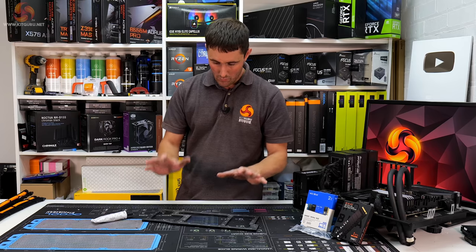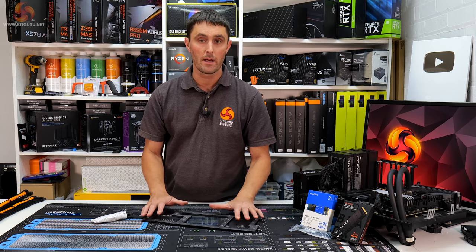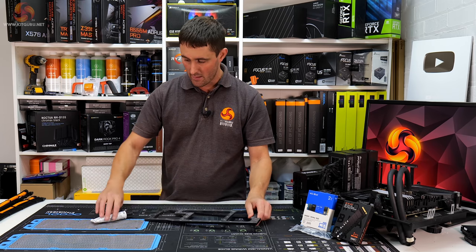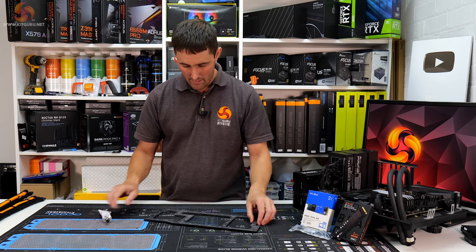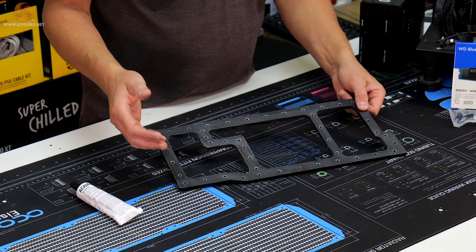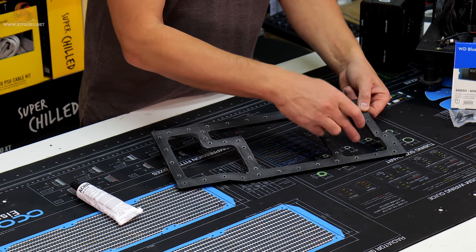Plan is now, as well as the 8mm central plate, I'm going to upgrade the top plate and the bottom plate also from 5mm thick to 8mm thick acrylic. And using this Acrifix, I'm going to permanently bond the bottom plate to the mid plate. I'm also going to add some baffles into this larger section here, and then another baffle into the second section